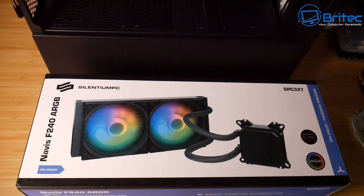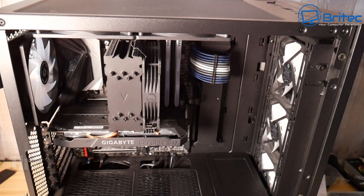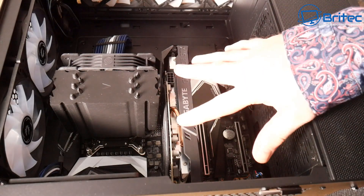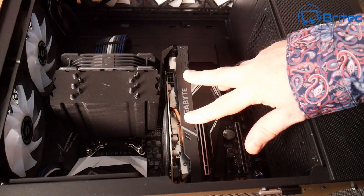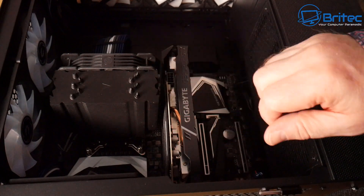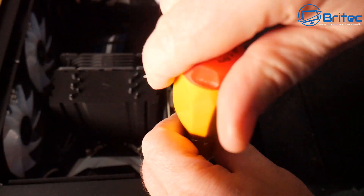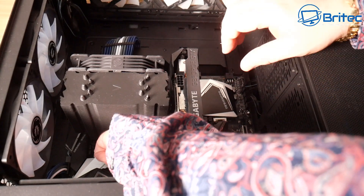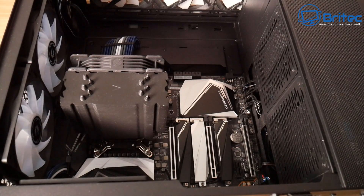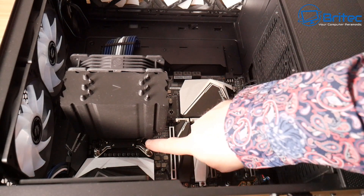Before we do that, we need to remove the cooler already inside the case and probably take out the graphics card. I'm removing the graphics card first so we can access the CPU cooler, and we'll also remove the two top fans since we're putting the radiator there. We may need to remove the RAM as well to get easier access. I'm using the screwdriver to release the catch and remove the graphics card — I've already removed the power cable. Once it's out the way, that gives us access to the four screws on the cooler.